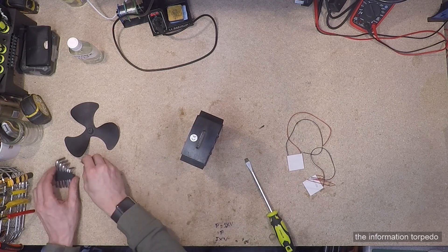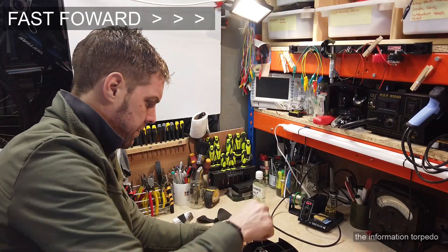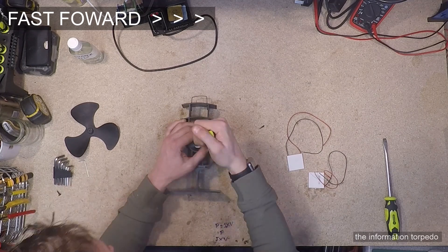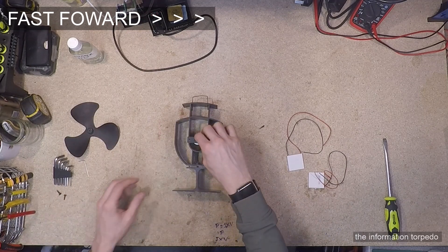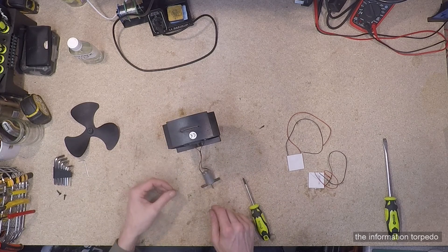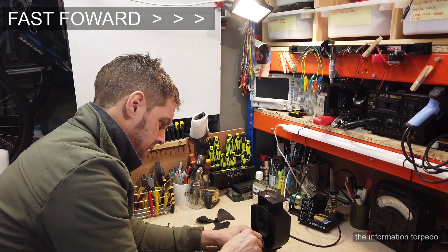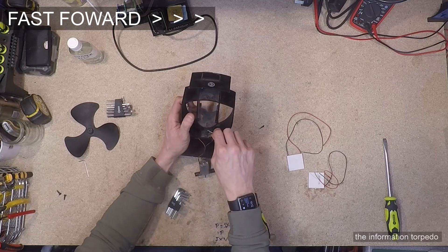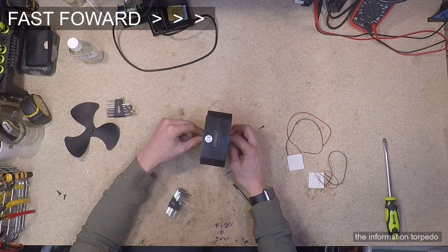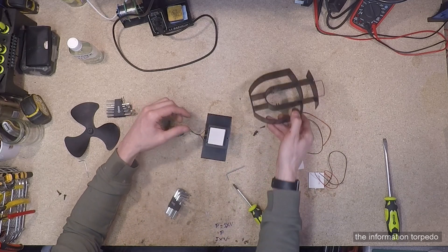The motor has to come out now — there are two screws on the side of that plate. When you undo the two screws either side, the motor will come out with the plates attached. These fans vary a bit. To remove the peltier module, on mine and most ones I've seen, there are two screws either side of the peltier. Unscrew them and lift the top extrusion off to expose the peltier, and that's it.